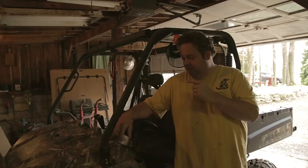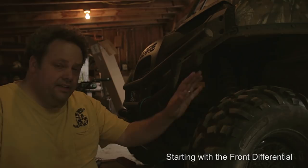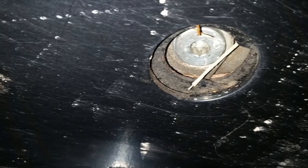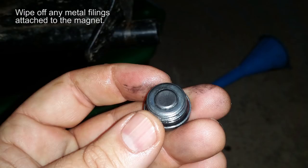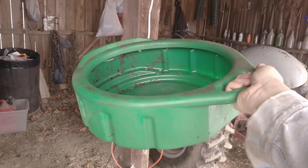There are two plugs you've got to move on the front end — the front gear case is right in here behind the driver's front tire. I can't get the camera in there, let alone both hands. You've got to take the drain plug out of the bottom and take the fill plug out of the side. There are skid plates on the bottom of your Ranger with nice big holes, and you can put the wrench right up through the bottom of that hole. I use a two-inch extension on my ratchet with the eight-millimeter fitting. The bottom one — you are going to soak your ratchet and your hands with transmission fluid, so put a drain pan up front. It all comes out at once.